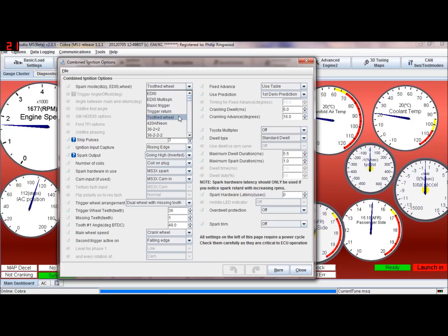Vauxhalls, Fords — all the normal standard wheel decoding would use tooth wheel. Then there are specialist modes for certain engines like the Subaru 6+7, Mazda MX5, G6, G72 cam sensors, Cosworth sensor setup, and twin trigger for two-distributor setups. The Rover K-Series has three different types of crank signal patterns, so there are three modes for those.